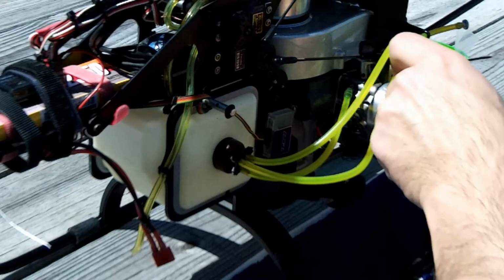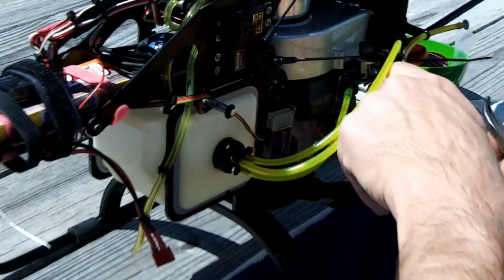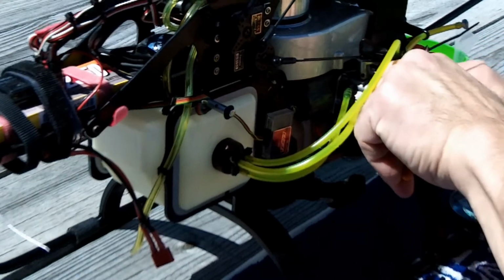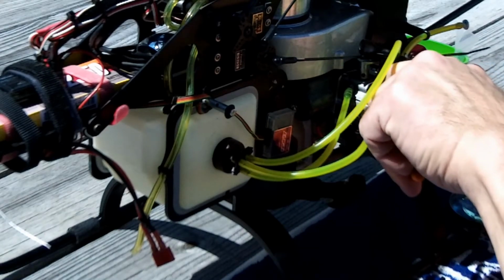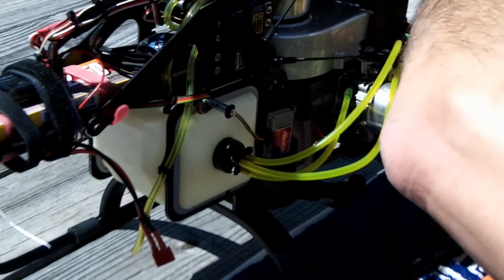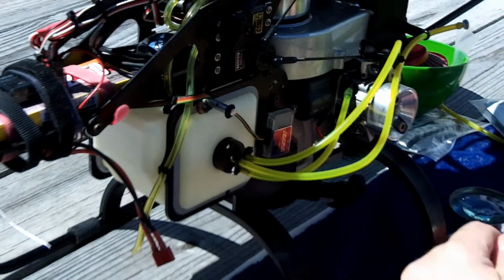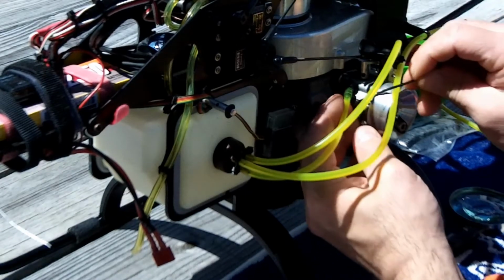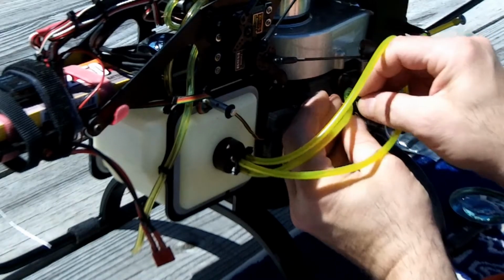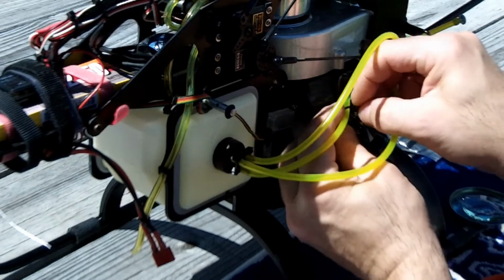But my whole issue here was it was going half tank and the bulb would go dry. I wouldn't be able to suck up any more fuel. And my mistake, I never tried filling the tank again and seeing if it was just a fuel line problem. So instead I just ran out today and got fuel line and said just bite the bullet and change them. Doesn't hurt. The old one was sitting used up in someone's attic, so at least this way I know they're new.